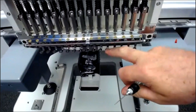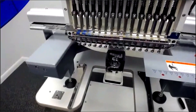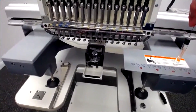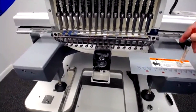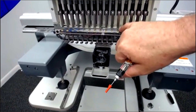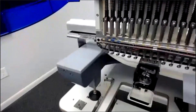You want to make sure the felt pads are not saturated but have enough oil that you can tell there's oil on them. This will help with the dampening — when the needle's sewing and this goes down and hits the pad, oil on the pad keeps it soft. Keeping it soft keeps it quiet. If it starts to get hard and brittle, you start hearing a louder noise while it's sewing, because at 800 stitches a minute, this metal piece is coming down hitting a hard felt piece of metal.